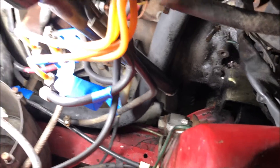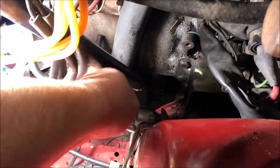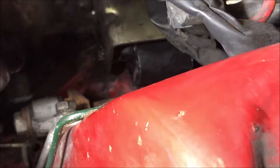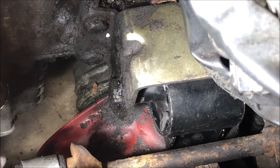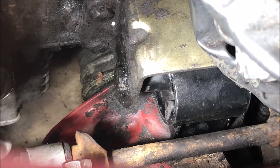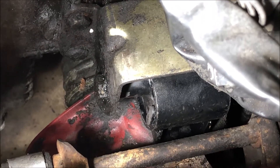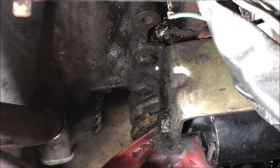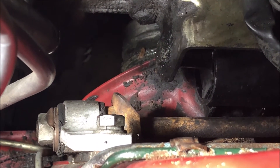Another thing that's kind of in the way is this oil fill tube and dipstick. It is plastic, and you kind of have to push it out of the way to get the bolt into the motor mount. On the top side, there's one bolt that goes through and that's a 17 millimeter head. I just loosen it up — it does bolt into the mount, this brass-looking piece on top, so there's no loose bolt that will fall down behind, but that bolt sleeves through the mount itself. Up here, just the oil filter and then the dipstick kind of has to be moved out of the way. I loosened up this bolt but didn't remove it, and then went down below the mount.